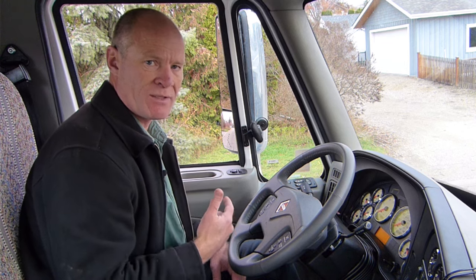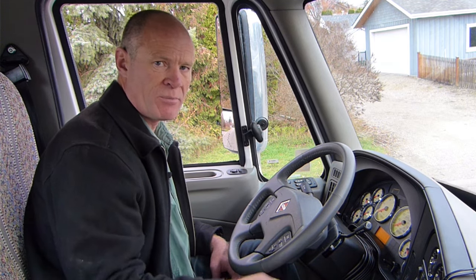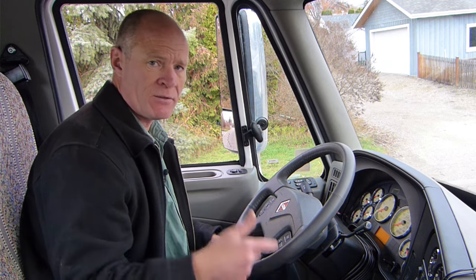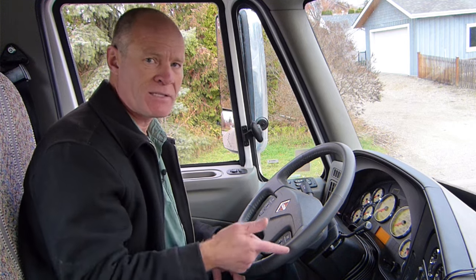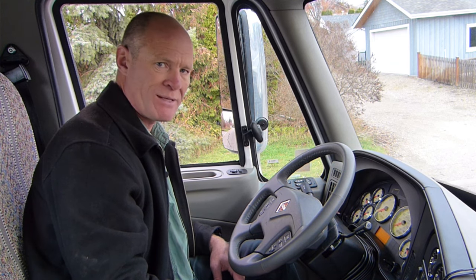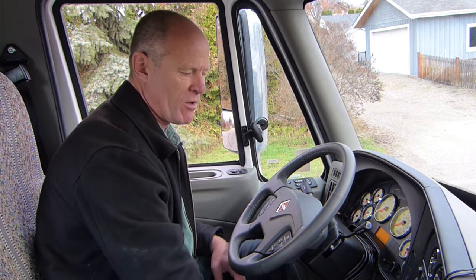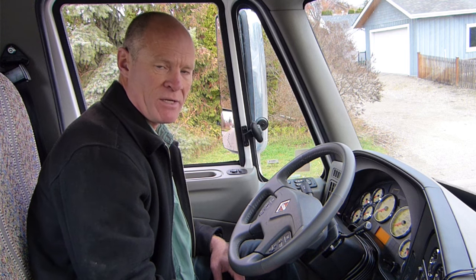Check the low air warning that it comes on at 60 or above. Let the spring brakes apply between 20 and 45 when you pump down on the air — make sure you shut the truck off because you don't want to be fighting the compressor when you're trying to pump down. Next, test the compressor that it builds a set volume of air within a prescribed amount of time at a high idle. The most common test is 50 to 90 pounds per square inch within three minutes. Build to maximum pressure — I hear the air dryer unload, I see the needles have stopped climbing between 105 and 135. Therefore, you know it's at maximum pressure and the governor has put the compressor into the unload phase. Shut the truck off. Full brake application on a single unit — you're allowed to lose three pounds in one minute after the initial drop. Four pounds on a truck and trailer and six pounds on a truck with two trailers.